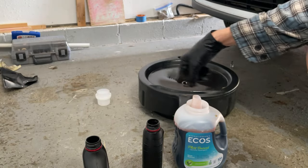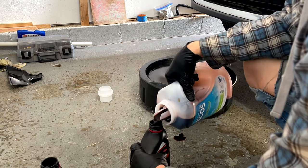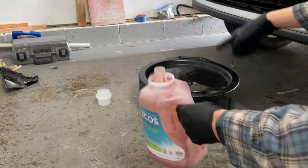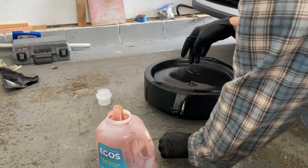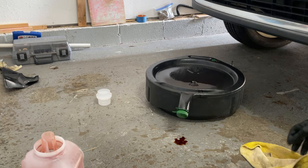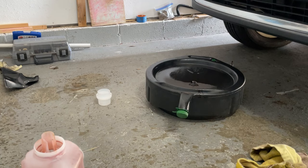While the third bottle finishes pouring in, we're going to start pouring these three quarts out into the bottles we just emptied. We got about half a quart, a little shy of half a quart, which means that's three and a half quarts total drained. I know I lost probably around two quarts when I pulled that CV axle out, as it all came out of the side of the transmission, so we're going to go ahead and start by adding a full fourth quart, then we'll start checking our fluid level from there.